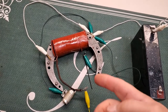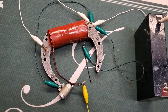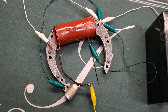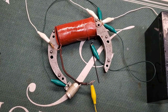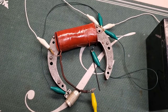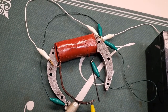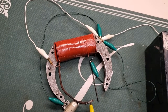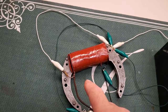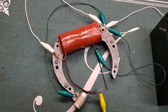And then this one here, somewhere down, I don't know, like the first layer, the winding had gotten broken. I can tell you on this guy, the wire is like trying to solder together hair, fine as frog's hair. So it took me a while. Even when I scraped the lamination and the varnish off the wire itself, the solder just did not want to stick to it for some reason. But anyway, I thought I'd share that with you. We got a good coil. I'll get it on the motor and we'll go from there, see if we can't get it running.